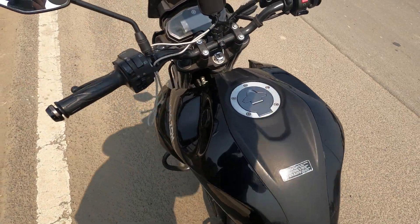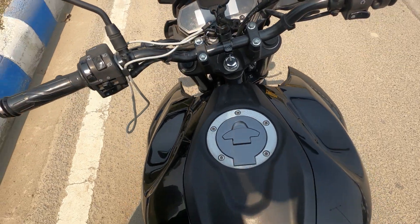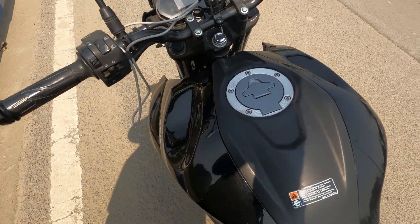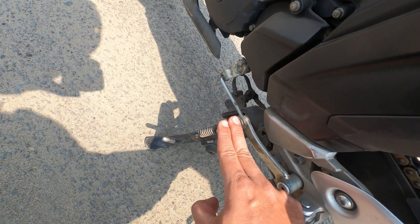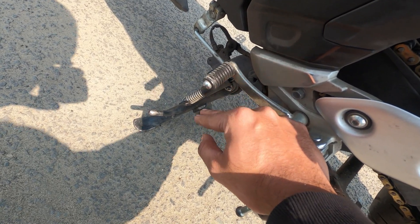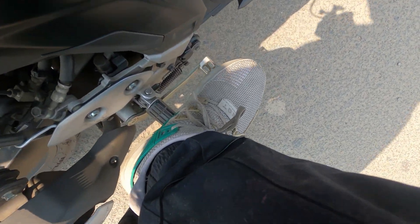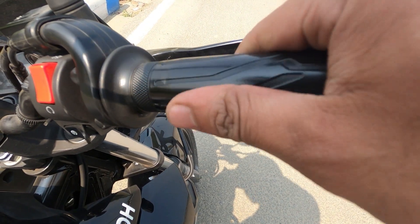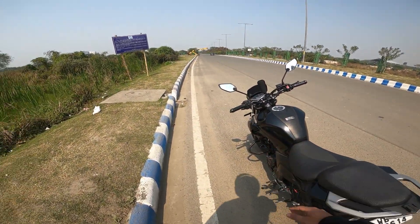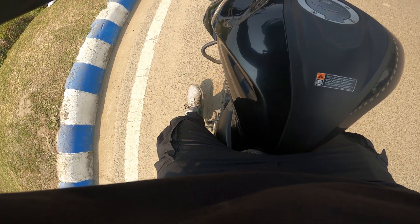I won't get into how the engine works, but I'll tell you the basics — the different parts of the motorcycle that you need to understand. The most important thing is whole body coordination. The left leg is for shifting gears — you click down to go to first gear, half click up takes you to neutral, and this is how you shift up and shift down. The left handlebar controls the clutch. On the right side, the right foot controls the rear brakes. The right handlebar has the front brake and the throttle. For other switches, use your user manual. To sit on the bike when it's leaning on the side stand, swing your right leg over, sit on it, push back the side stand, and you're good to go.